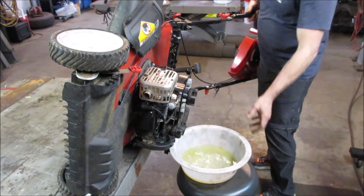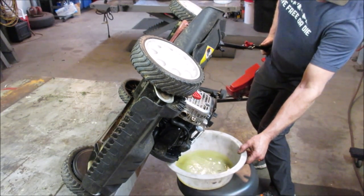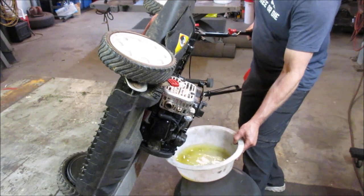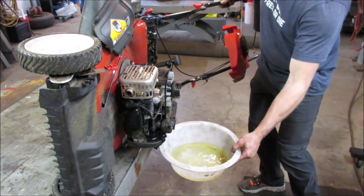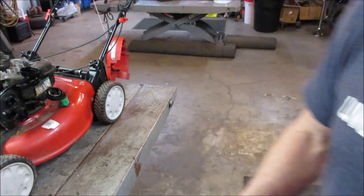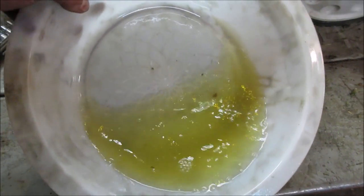You can see there's some stuff spitting out of it. The very bottom of it was not very pleasing. There's a mixed opinion on fuel storage — it's good if you can get all the fuel out, but if you can't, fill it all the way to the top so there's no air space for moisture to travel. You can see how cloudy that is — there's just crap in the bottom, you can't even see it. Looks like ants and yard debris in there.